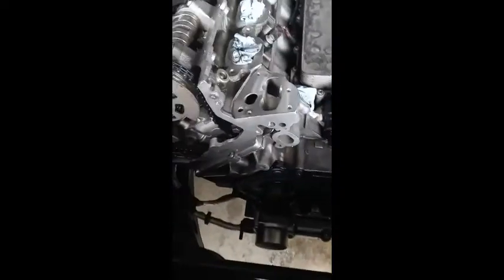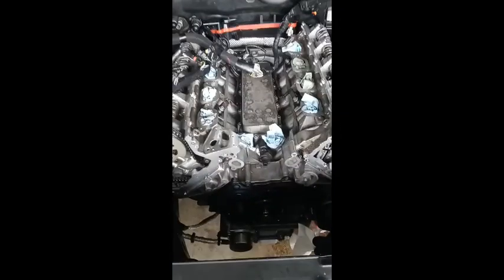Okay, you guys, we're getting into some of the final steps here on the AJ133 5.0. This is a Jaguar XF Premium, 2011 late model. I've got the cover on, getting ready to put the crank pulley, and everything's timed. Timing mark. Made sure all my knock sensors were connected. Water hose is on. The oil pressure valve is on the back side of both of these here, and I'm getting ready to put the pulley on. Get right back with you guys.